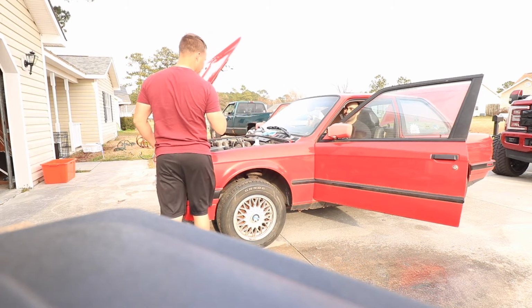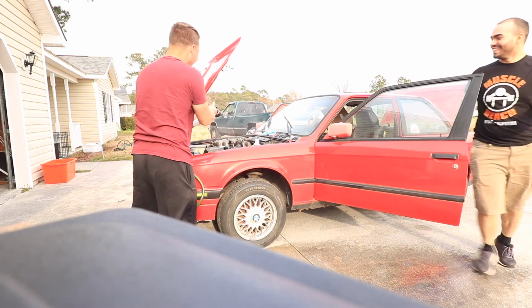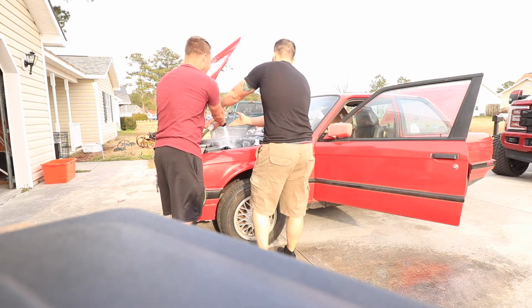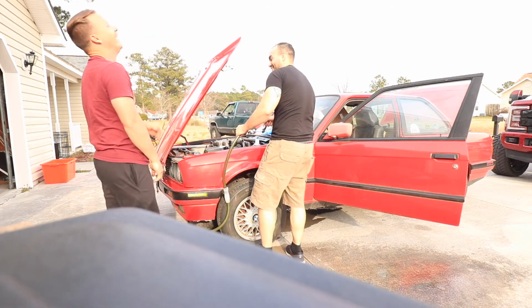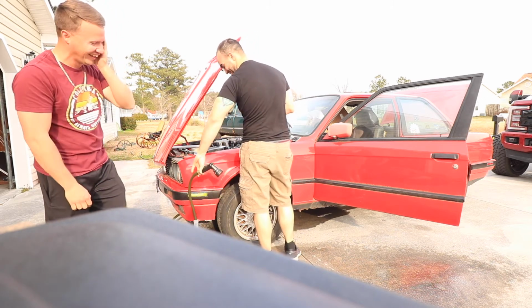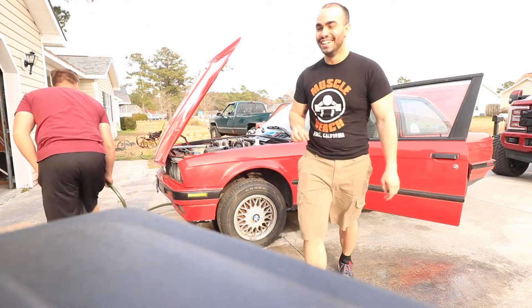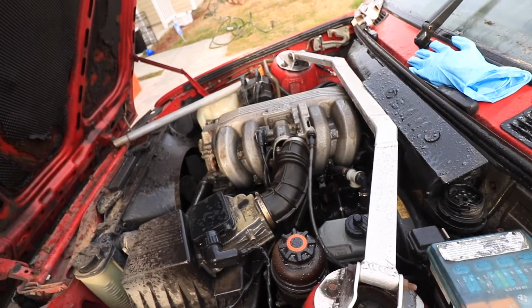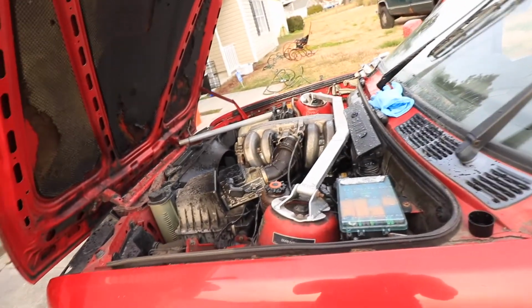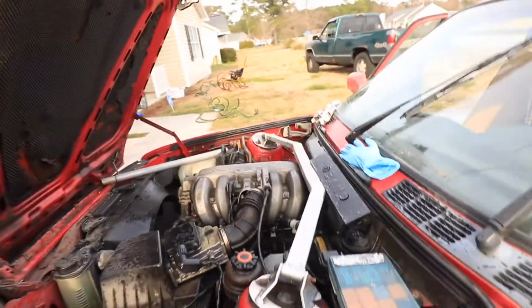Hold the gas wide open. Keep going. Don't get in the motor. That was like down there, was on fire. Alright, I think we're done with this. No more starter fluid. At least the windshield wipers work, but we're not gonna do that no more because I think we're either using the starter fluid wrong or something's not working right. It sounds like it's got compression in two cylinders and the other two cylinders don't have compression. Until they caught fire.